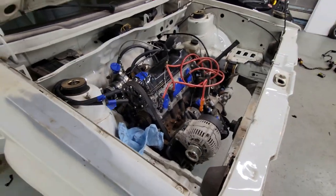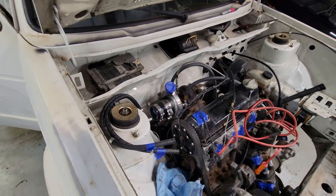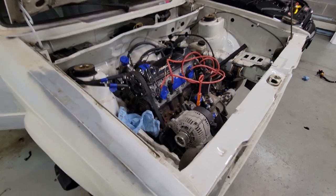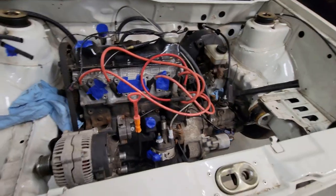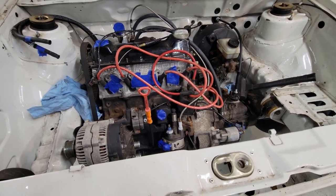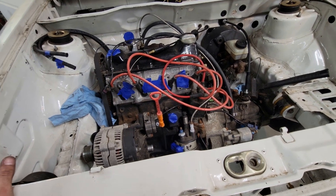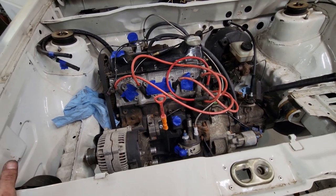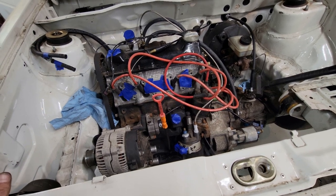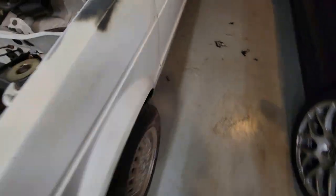Here's what we're doing. As you may notice, it's got an ABA in it. You also may notice it has a turbocharger. So, we are going to be reinstating this car as an ABA turbo with a full central electric CE2 swap. And basically the only things that will remain Mark 1 in this car will be some of the blower wiring, the wiper motor, which I'm going to rewire with Mark 3 wiring, and the rear taillights. And that's about it, honestly.